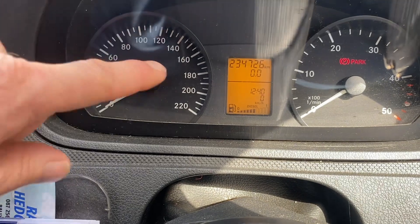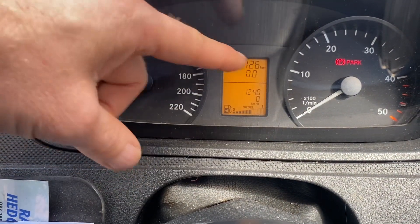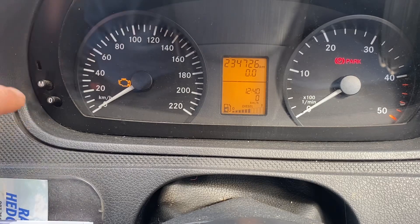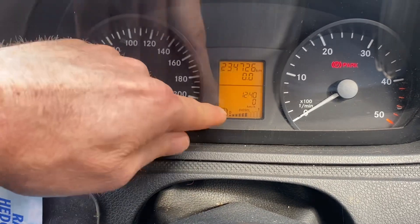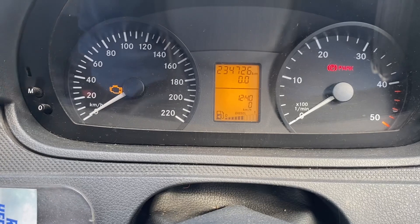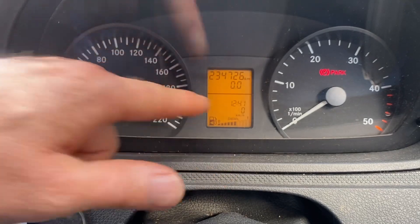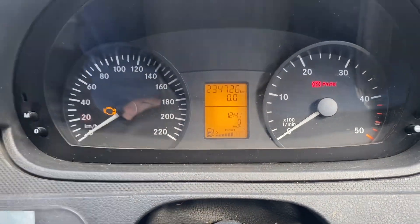Just to reiterate: press and hold zero on the first occasion, hear the beep. Once you change the menu onto Reset 3.1, at that point press and hold zero again — two will flash. Once two flashes, press and release rather than press and hold. That will reset it, and it will come up Reset Done. The service light has gone off.